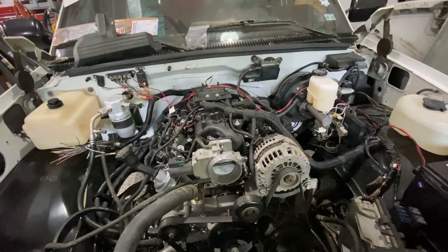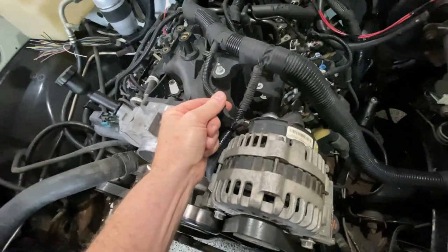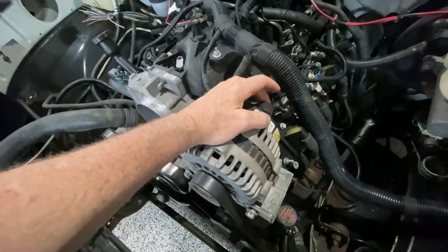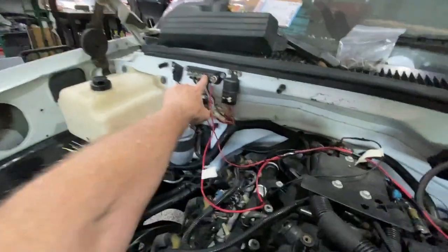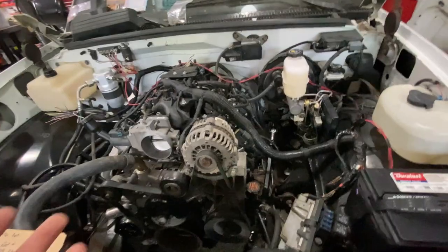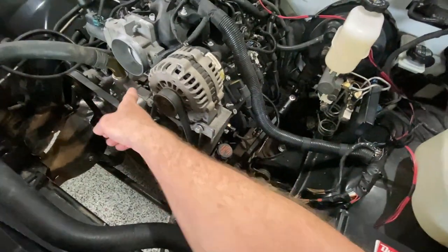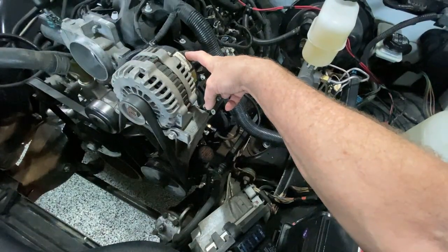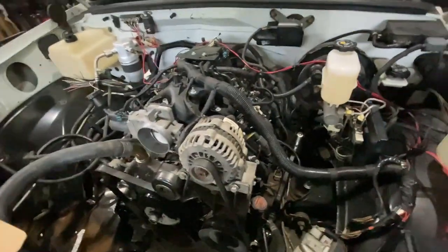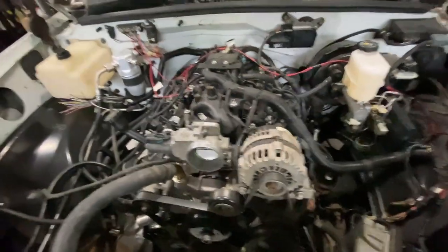The volts are your battery. There are two plugs — a plug that goes to the alternator in the LS harness, and it plugs right in. The wire that connects to the back of the alternator to give it power runs right over here to your power leads. On the Suburban donor, for example, the positive wire that comes off the battery runs over next to the alternator, down and under, over to the starter. There's a little box there, and all it is is a wire coming off that main power to give power to the alternator. I simply used the wire that was already here for the OBS to power my alternator.